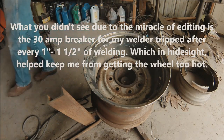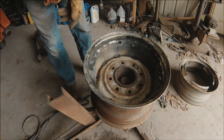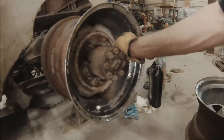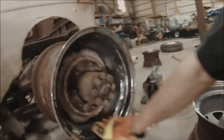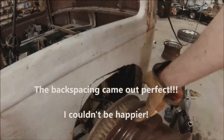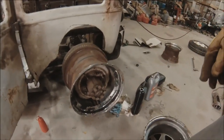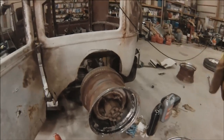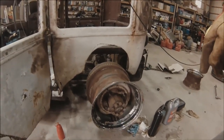I'm gonna give that a chance to cool off and try it out on the hub. I think it turned out pretty good. As you can see, it draws up on there and it's just perfect for my spacing because this is a 15 — it wouldn't be able to flush up on there anyway, so it's still hanging off a little bit. Once everything gets a chance to cool off, I'll go back over, hit some more welds on it, clean it up, double check my welds. I'm gonna do some welding from the inside with the wire feed welder, but I'm gonna call that done.